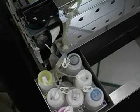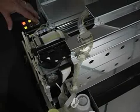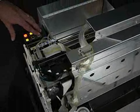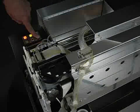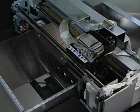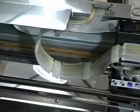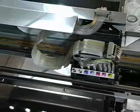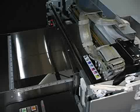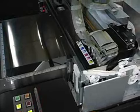To make sure the printhead is completely flushed of any remaining ink residue, we're going to run several head cleanings with this cleaning solution instead of ink. The crystal inside the printhead firing the jets is what actually pushes the cleaning solution through each individual jet. I would recommend doing 10 or 20 of these — the more you do the better, it's not going to hurt anything, just make sure you don't overflow your waste tank. Press and hold the ink button for three seconds to begin a cleaning cycle, and repeat.